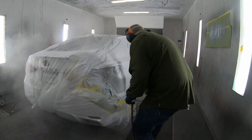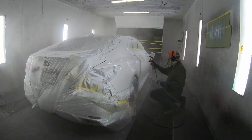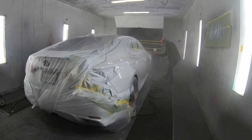The passenger side doors and quarter panel were pretty straightforward repairs. I just used my stud gun slide hammer dent repair kit and got in behind as best I could to straighten out the metal before going in with some body filler and priming the areas. Once that was all blocked out, it was time to get into the paint booth.